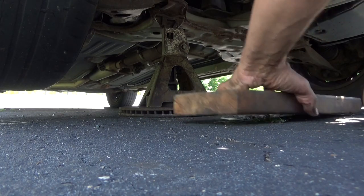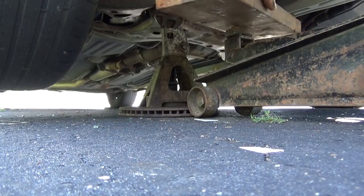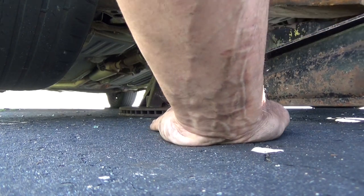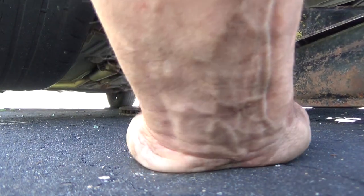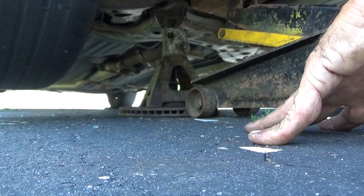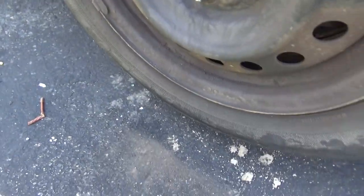Now, in order to protect the oil pan from being crushed, put the jack underneath with a board on top of the jack. In this case, we're going to go this way here in the front. This way here, we can support the motor and disconnect the motor mounts. Get that last one out of there. Wheel off, and as usual, put it underneath the vehicle for extra security.